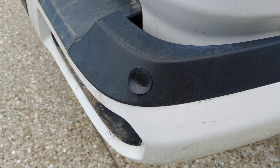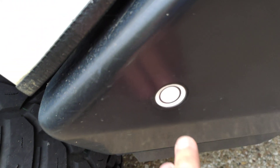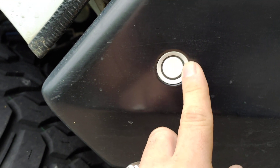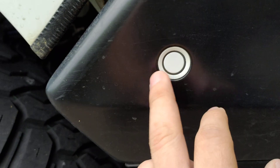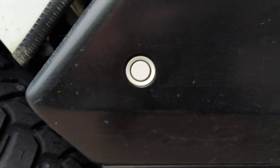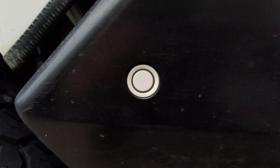The other thing that can happen is if you've had a bull bar fitted or recently powder coated. What can happen — and I've seen this more on Colorados — is when they put the powder coating on, or re-powder coat something, the coat ends up too thick. They've got to push the sensors in very tight and it actually bends the plastic slightly on the sensors, causing erroneous readings. My mate Nick had this with his Colorado bull bar because they shipped a black one and he wanted it white, so they just powder coated white straight over the black.